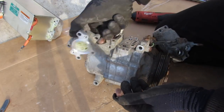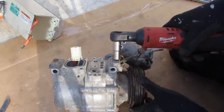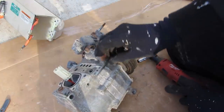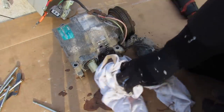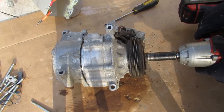This looks like a junction block, and you're left with the plug for the motor. I'm going to remove all these 10mm bolts going around here — this is a really long one that holds the whole assembly together. The AC compressor is leaking oil, so I'll wipe that up. Now I'm going to knock off the clutch bolt.